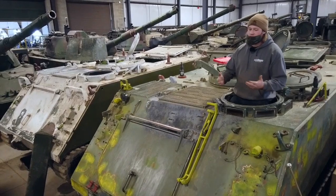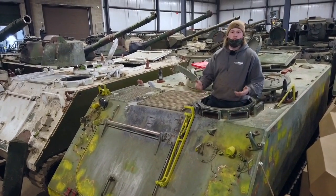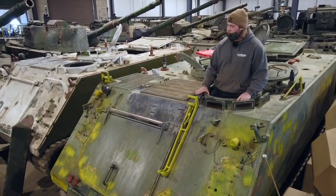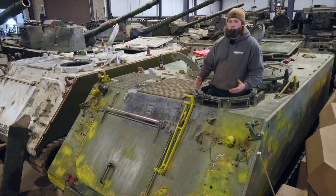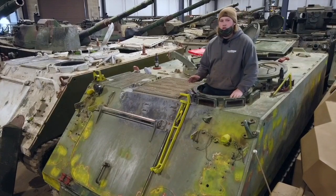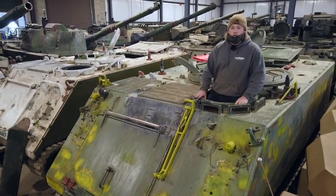As you can see, we probably have all the lights off, the bow planes off — everything's yellow. It's zinc chromate, which is aluminum primer. This vehicle is made of aluminum except for some small parts. We're in the process of stripping everything, sandblasting it, wire brushing it, making it all nice and neat so it looks immaculate when we paint it. We're going to be painting it a very dark olive drab, the type they would have used in Vietnam.